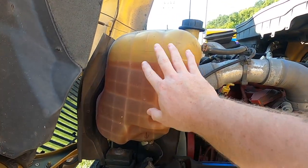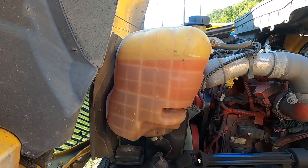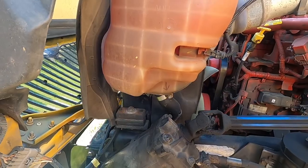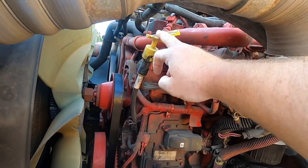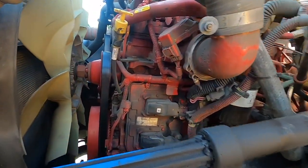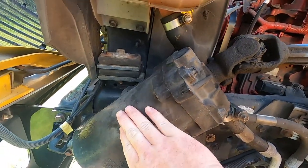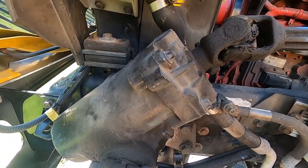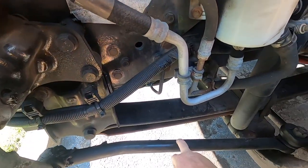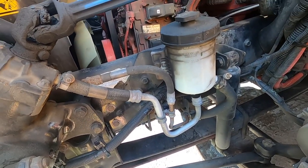From the driver's side compartment, you'll find your radiator fill reservoir — make sure the cap is on, it's at the appropriate level, properly mounted and secured, with no cracked or damaged hoses. Your engine oil dipstick is here; check that your belt is in good condition, your upper and lower radiator hoses look good. You also have power steering fluid here. This is your power steering gearbox — make sure it's properly mounted and secured, nothing cracked, damaged, loose, or leaking, with all bolts present.